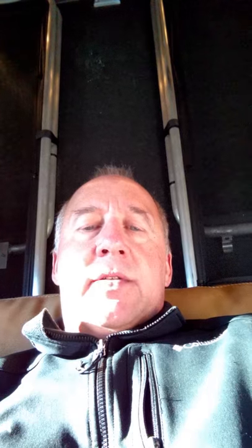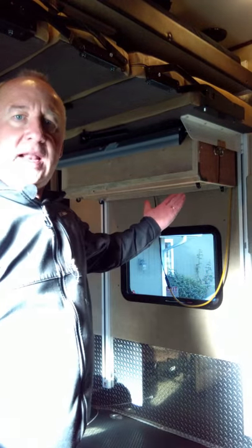Another tip: once you get started on this project, do not move the bed or the mechanism up and down when you've got that stuff unclamped off the chain, or you'll never figure out where to put it back. Stop the chain where you want to work, mark the locations of your brackets, move them up one tooth or down whatever you think it takes, then reassemble. Do not move anything in between or you're going to have a hard time figuring out where to put it back.